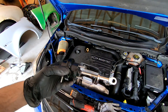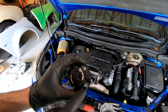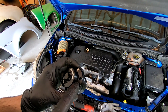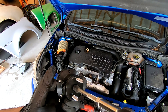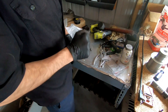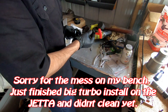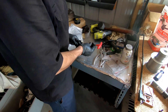I just took the wastegate actuator out. I think it's important to note that I did tighten all these down in the other video, but one came out. Maybe these require some Loctite. So if you are doing a Mamba wastegate actuator install, definitely throw some Loctite on these bolts if you're changing the spring out. I need to go find some kind of bolt to replace this with. I'm definitely going to be putting some Loctite on these. I may have gotten lucky and found some Allen screws I could use — I just don't know yet, but I'm going to try and match them.